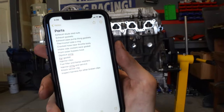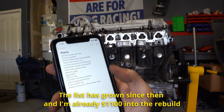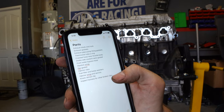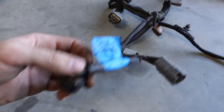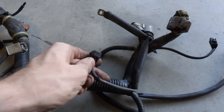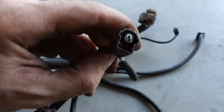I've made a lot of progress — the intake manifold is off and I'm working on a parts list of everything I'm going to have to replace. So far: exhaust studs and nuts, gaskets, exhaust pipe pump gaskets, thermostat tube O-ring, cracked hose near throttle body, bypass hose, dipstick O-ring, EGR gasket, injector clips, fuel filter banjo washers, knock sensor clip. The harness is actually in really good condition — better than my pickup — but every single injector clip broke, all six of them, plus one knock sensor clip.